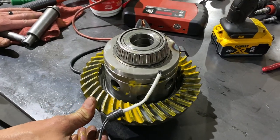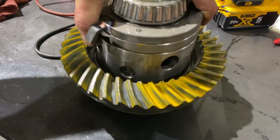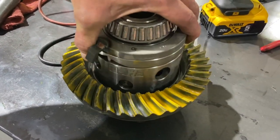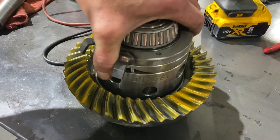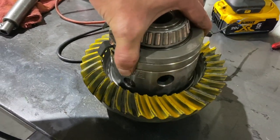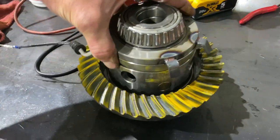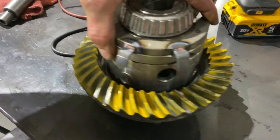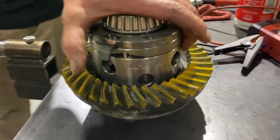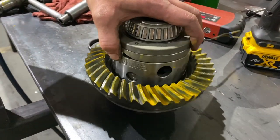The coast is looking pretty good now. Drive looks pretty good too — could be a touch shallow. That's the difference between three thousandths right there. I said two, I should have stuck with two. The coast does look good, but that drive has gone just a touch shallow — meaning the contact is up on the face. Just a touch though — we're splitting hairs at this point. One thousandths difference between three thousandths. Started at seventy-nine, I'm at seventy-six — seventy-seven is the magic number.